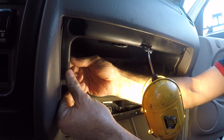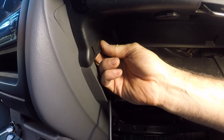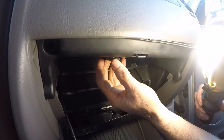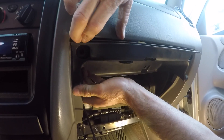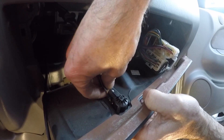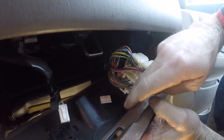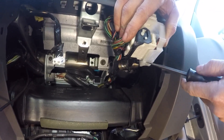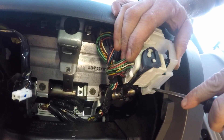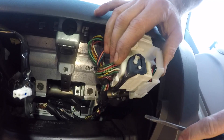The clip is released. There are also little push tabs here — just push toward the inside or toward the glove box and they pop off. Inside there are some electrical components we have to disconnect, including the glove box light — just a push tab on top, then pull it free. There's also a clip on a plastic harness for all the wires that clips into the cover. You have to pull down on this clip and push backwards at the same time to get it free.